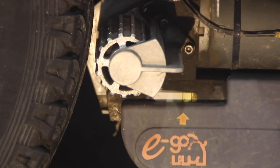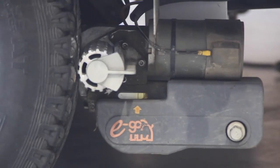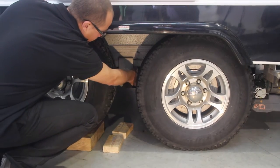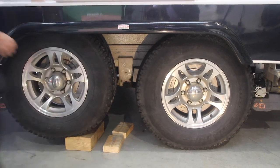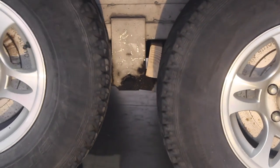And the solution is simple. Just lock out that roller rocker action and the wheels will remain firmly engaged with your movers. All you need is a block of wood to lock up the swinging shackle, and your van rides easily over uneven ground with the shackle locked in place and the movers securely engaged.